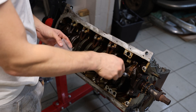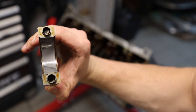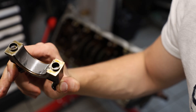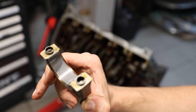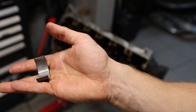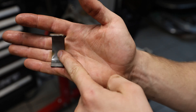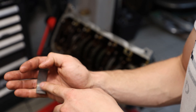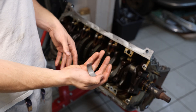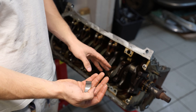I've pre-loosened all of these bolts — they'll have to go back in the same position. This bearing actually looks pretty good for the kilometers this engine has, but it's already gone through the first coating and the second is pretty much through. The bottom part doesn't get as much load as the top, just because of how the engine works. The top bearing looks worse — it's down to the copper base right there. Because of the rod pushing down onto the crank, the top bearing always has more wear. It would have still made many more kilometers, but it's definitely time to change these. So 290k on the rod bearings — the main bearings should do 400k no issues.